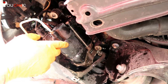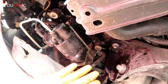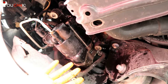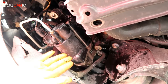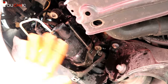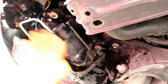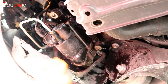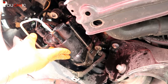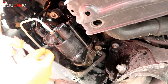It's not going to throw the error all the time. You might be driving down the highway and then all of a sudden you'll see an error message for the air suspension on the dashboard. But generally it seems like everything is working fine — if you just give it time, the compressor will raise the car and seem to be working properly. In fact it's starting to wear out, so if you have issues like that where you just have random Airmatic suspension errors, this might be the problem as well. But let's just get going with replacing it.